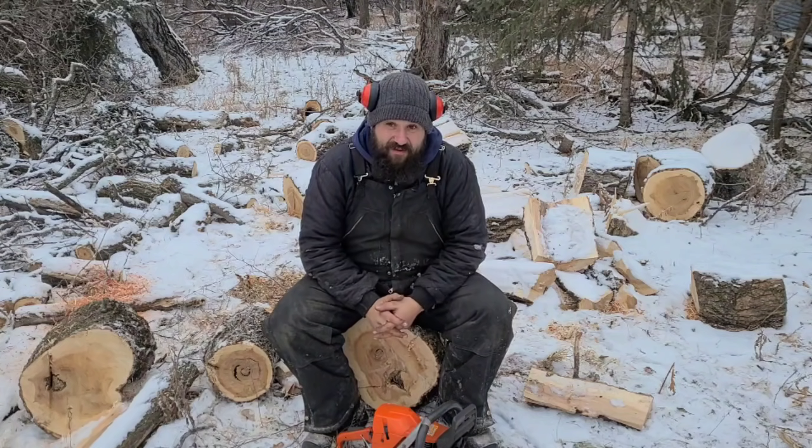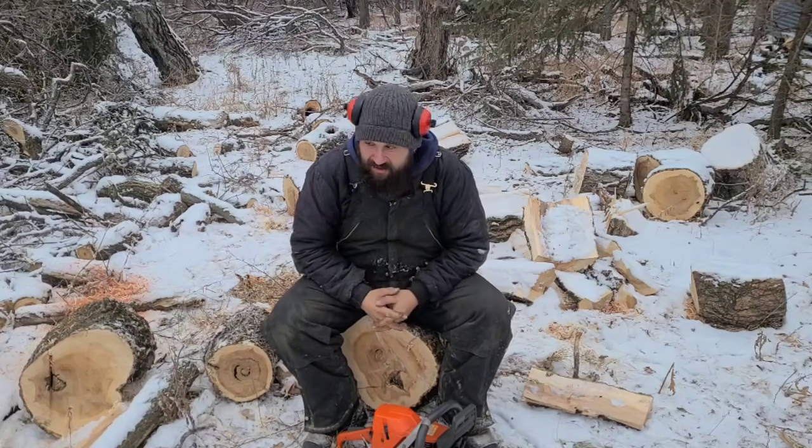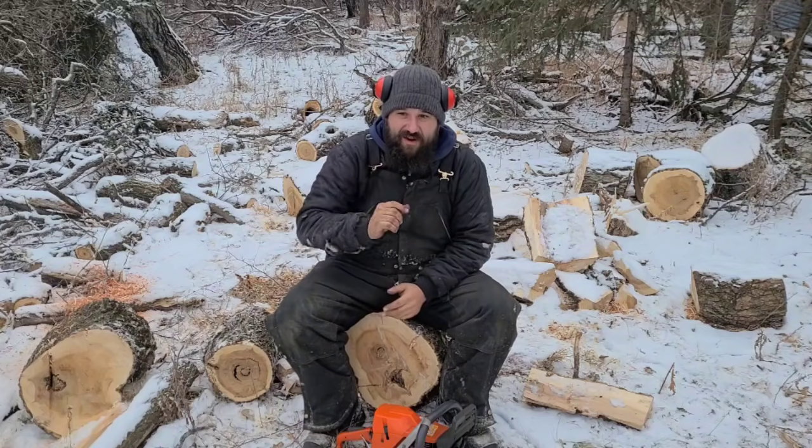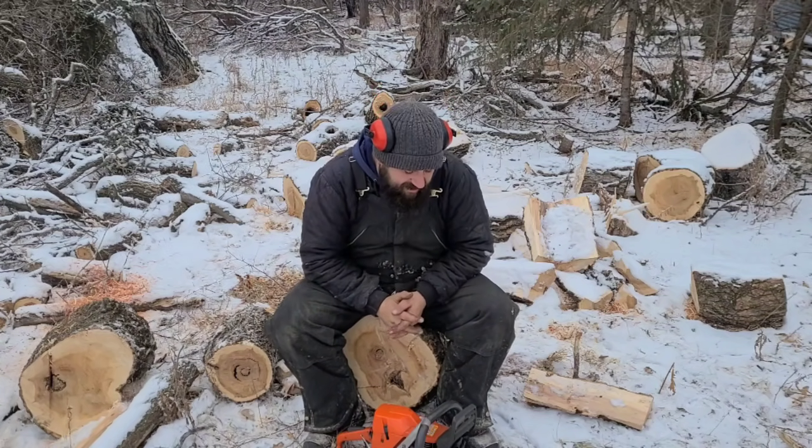Well, there's lots of different ways to do it. I'm going to tell you my way. There's other ways. I like my saws a little rich. And what a little rich means is the high jet is open a little bit more than maybe it should be. That's just how I run my saws when I'm working. It does slow them down a little bit, but you'll never burn a saw up running a little rich. Also, if a saw is a little rich, they tend to be a little torquier versus when you get them right on the edge of leanness.